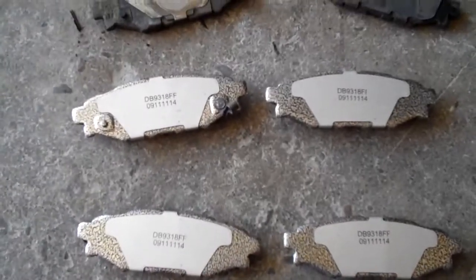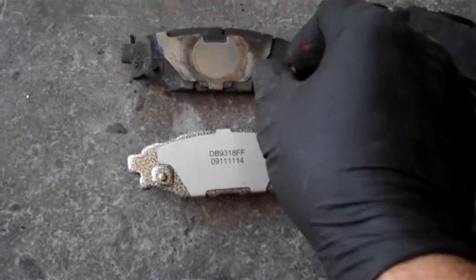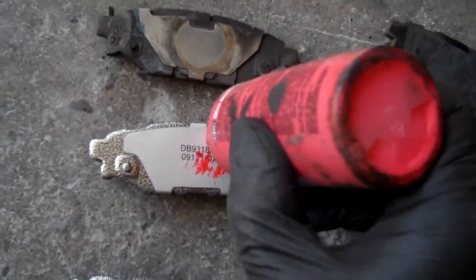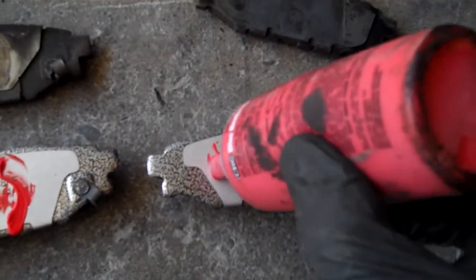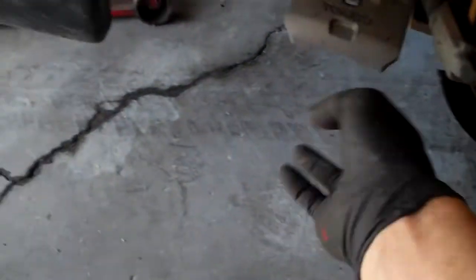Lay out your brake pads and look at the way that your indicators are. This is the piston side — you can tell because it's a circle. So you trace out the same shape that you have on your new brake pad, do the same thing over here. Now that corresponds with the two fingers that are on your caliper, so you know that one goes on the outside. Put it into your clips.